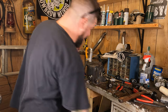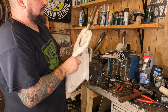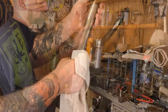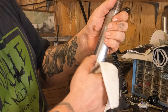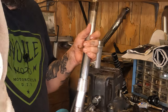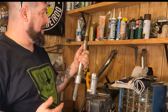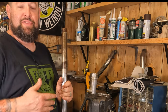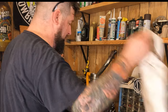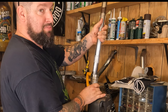From there, wipe this sucker clean and just slide this fork seal right up off of here. Give it a second to finish drip-drying, wipe it down. This is the point where you want to give the shaft some inspection — you want nice smooth chrome here. There are a bunch of scratches on this — horizontal scratches, vertical scratches — all in the chrome. Basically what's going to happen is I'm going to put these fork seals on and they're probably going to go out because those scratches are going to tear up the fork seals.